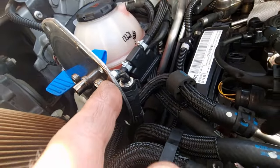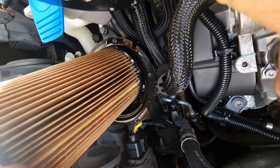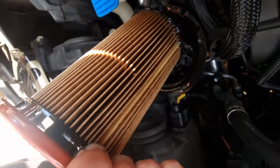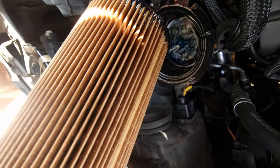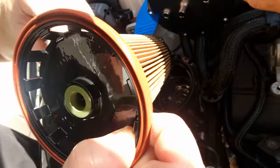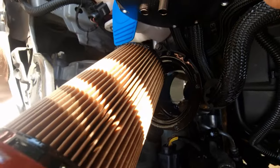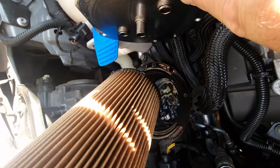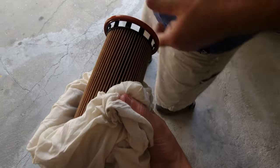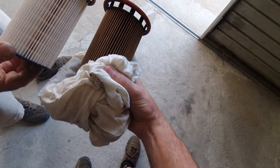It's a messy job but the diesel dries off, so not a problem - it's like cleaning with petrol. Here we use 95 or 98 octane and it dries really quick. Diesel takes a bit longer but it will all dry up. You can see the filter has dark shadow marks - that's why it's important to change the fuel filter. We almost change it at every maintenance. It's not that expensive - it costs about 15 bucks for a Mann filter.